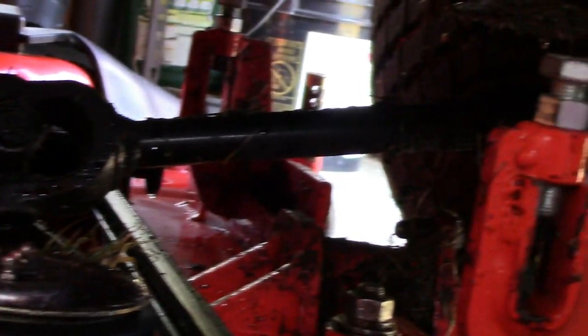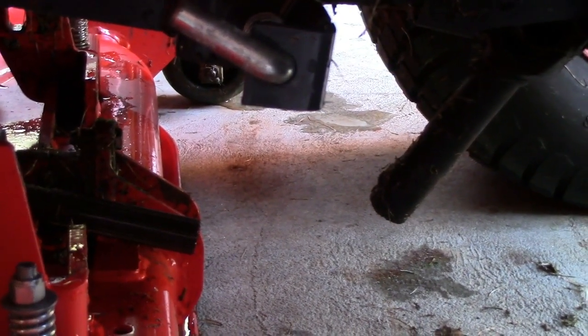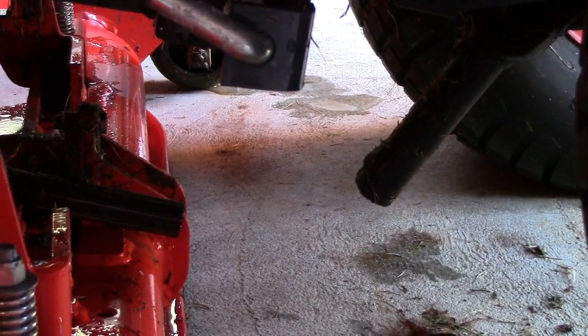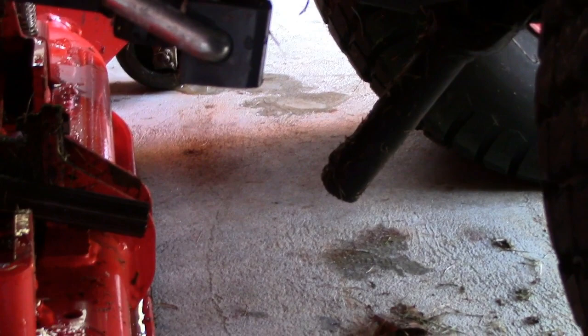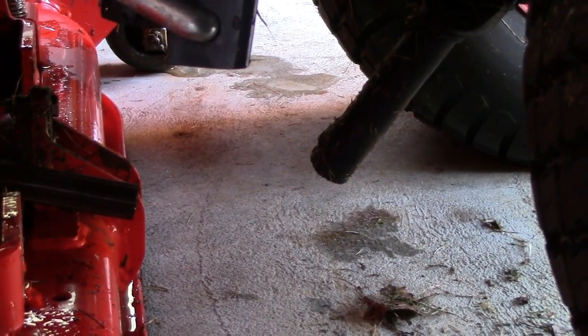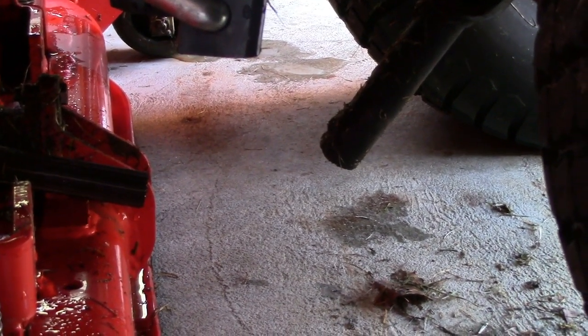So there's the center mounted drive shaft, and that comes off the midpoint PTO, which is located here. So what I've got to do is just grasp that large, spring-loaded collar and simply pull it, and that'll come free. But that's easier said than done. There's a little trick here. If you just let the mower deck roll forward, the drive shaft will disconnect at the spline, and you can take the deck out from underneath and then have plenty of room to uncouple the PTO.